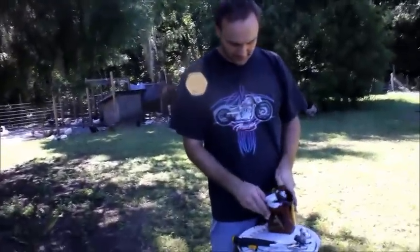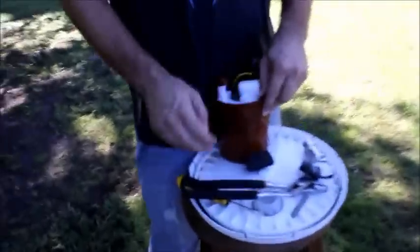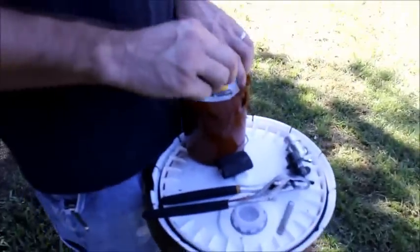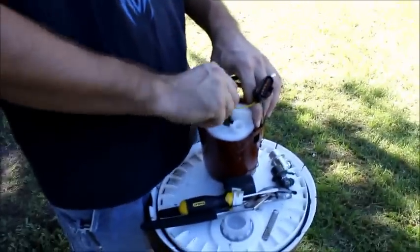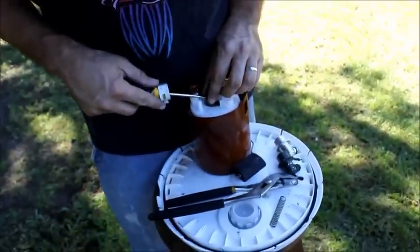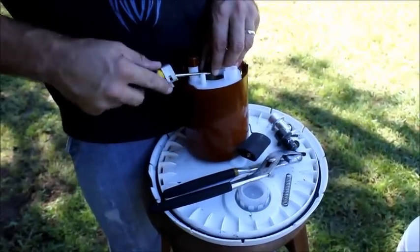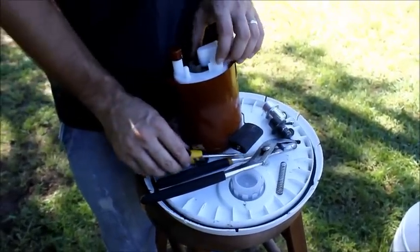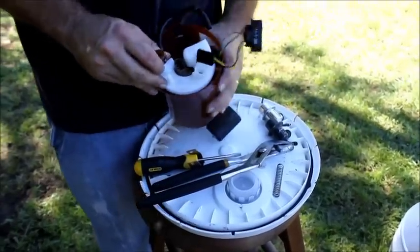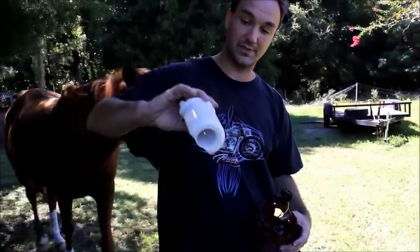Old fuel pressure regulator. So what we need to do is pull out the entire filter assembly. It's got a tab here and a tab here. If I remember correctly, this is a total pain. Go ahead and unplug the fuel pump power supply while we're at it. Push that wire out of the way and then this whole assembly will slide up. Now that the fuel filter - believe it or not, that's a fuel filter.